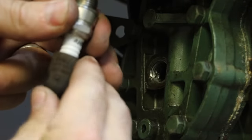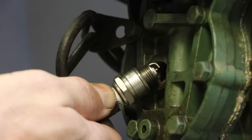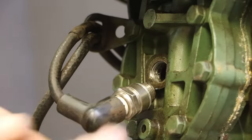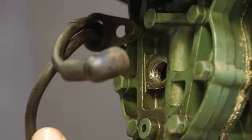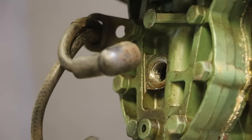Nothing. This is with the plug that looks like new and I'm on the other wire now. Good spark on that one. So this thing fooled me — it sparked when I first tested it, but once I finally got it running, it stopped sparking. So what do we do about that? The answer is we need to get to the points, which are underneath this flywheel here.